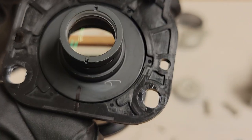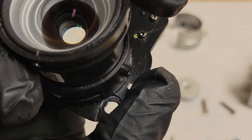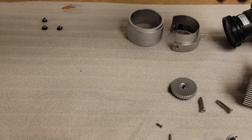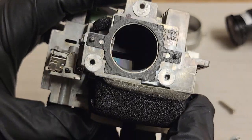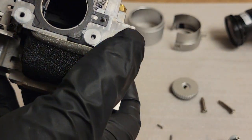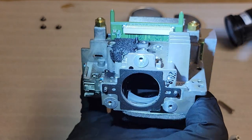Let's see if the camera sees anything, because I am not seeing anything at all that makes me think there's a problem here. That actually looks really good. You can see the lights reflecting a lot easier now. So I don't think it's in here. Now we're inside. So my suspicion is the shape lens, crud on the DMD, or, oh, that's all I got right now. Let's see.